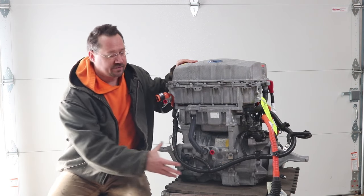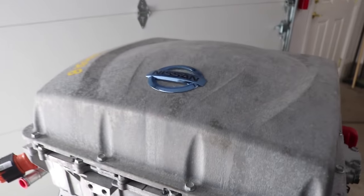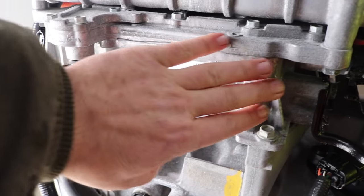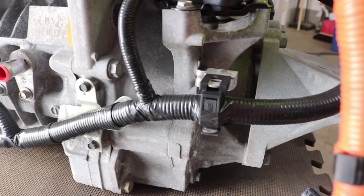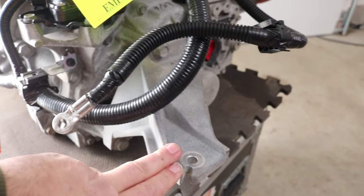What I want to do is just get the motor out of this whole thing, so we're going to take this apart. Starting from the top and working our way down, basically under the cover here is the charger and some other bits. This middle layer here is actually the inverter — it takes our DC battery power and converts it to three-phase AC power to run the motor. The motor is this section right here, and to the side of that we've got the gearbox. Most electric cars do not have transmissions; they typically have a single speed gear reduction. And this does still have the mounts on it, so I'm going to take those off as well.